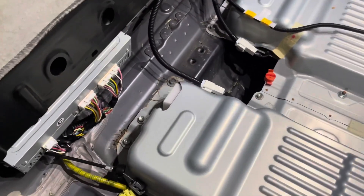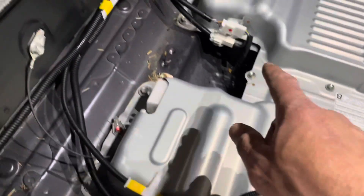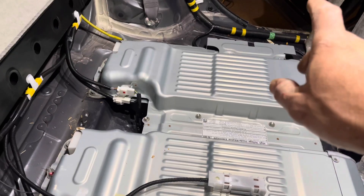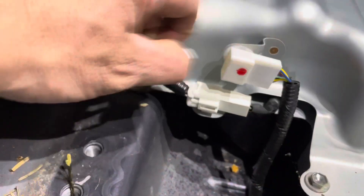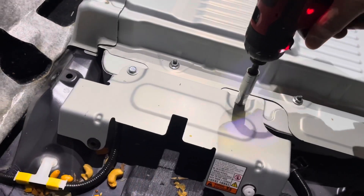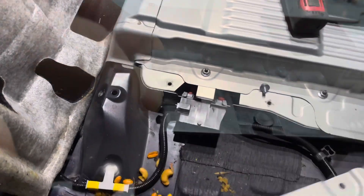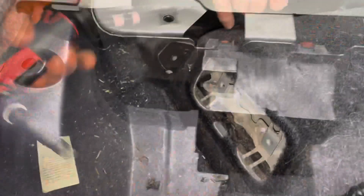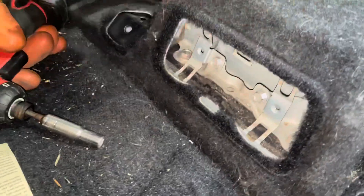Next I'm going to make sure all my wiring harnesses on the battery are disconnected — I have one, two, three, four, five — and there should be one over where the service plug is. I'm going to go ahead and remove the cover over where the safety plug was. Always forget these two. This vent housing has to come out as well to get to the anchor bolts on this side of the battery.